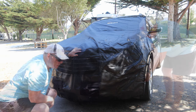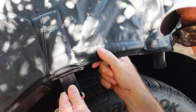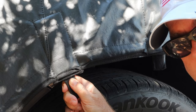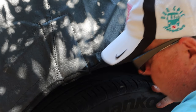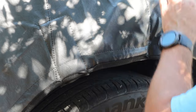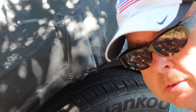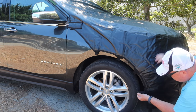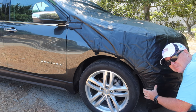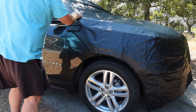Now go to one side — doesn't matter which side — and start securing it. All around the car are these little tabs; they have elastic on them so you can pull them out, and they're bendable metal. You're going to pull and then bend it over, doing that all the way around. Once you've got one side done, go to the other side, pull it tight, and readjust the top where the windshield cover is. There are also little tabs all the way around the front. Work it until you get it tight — pull them out and bend them in. This one here helps pull it back and keeps tension on the back.